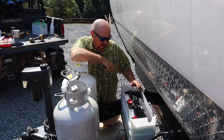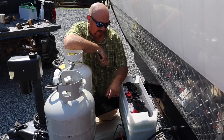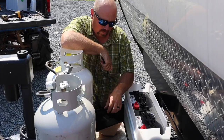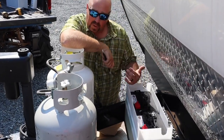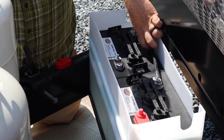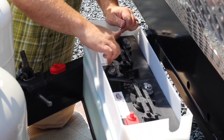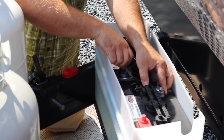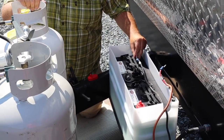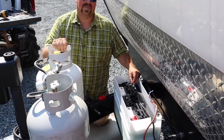With two 6-volt batteries running in series, you connect the negative from one battery to the positive from the other battery, then hook up your terminals like normal — red on your positive. It's hot out here, but supposedly it's a dry heat, right? I think hot is hot.